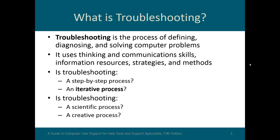Once you know how a laser printer works and how it pulls the paper and which roller pushes the paper and then how it grabs the toner, and everything that they show you, like, I don't know if you've ever studied for Net Plus, they used to make you memorize the positive corona, the negative corona, and then the photosensitive drum. All that stuff is built into the toner cartridge itself. And then there's a heating unit in the back, and then the paper spits out. So once you know how everything works, if the toner is not sticking to the paper, the heating unit's probably bad. If the paper is getting too hot or not hot at all when it comes out, it's probably the heating unit. If the toner is scratchy and some's here and some's not there, it could be the photosensitive drum. So once you know how things work, it's a lot easier to diagnose problems.